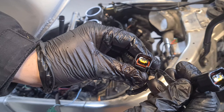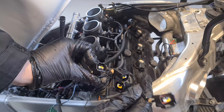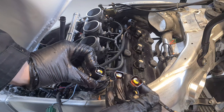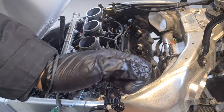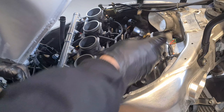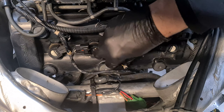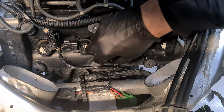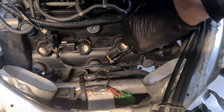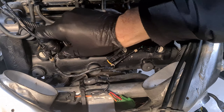Just checking that the coil plugs are all clean — I'm going to spray them with some electrical contact cleaner so they look okay, and make sure they're all clean as well. If the coils were corroded then it's possible they will be. Make sure they click in as well.